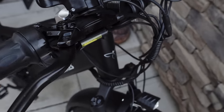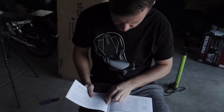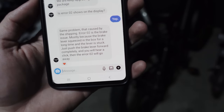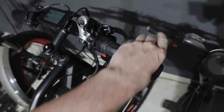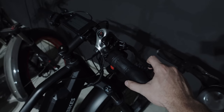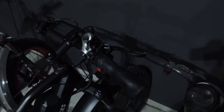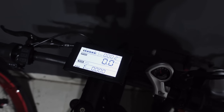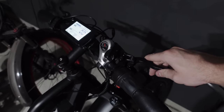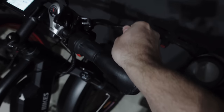I found the reason the brake doesn't work - looks like there's a fluid leak. Error code 2 - brake. That's probably why that one says Error code 2. I got in contact with Be Cool e-bikes and they said Error code 2 is actually because the package gets damaged during shipping and the brake gets pressed - that's why it broke. Error code 2 is fixed by pulling the lever back until you hear a click. I was curious why the brake light stayed on - that would actually do it. Let's turn it on and see if it fixes it.